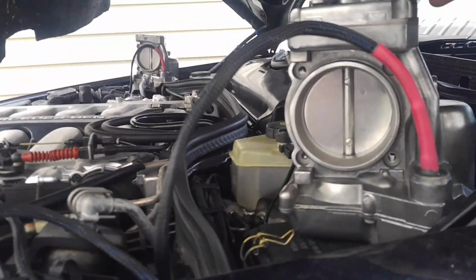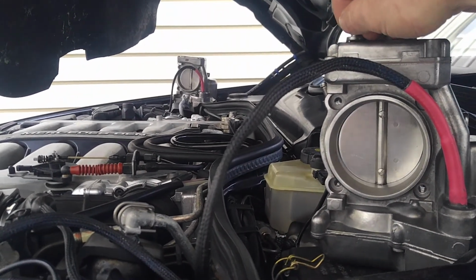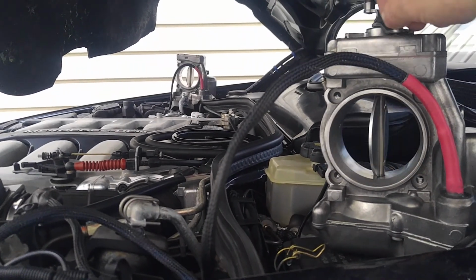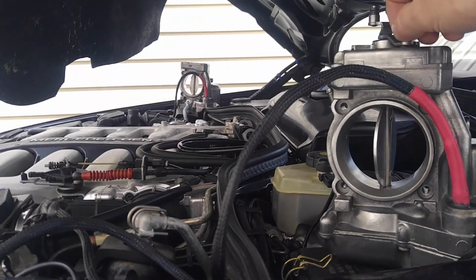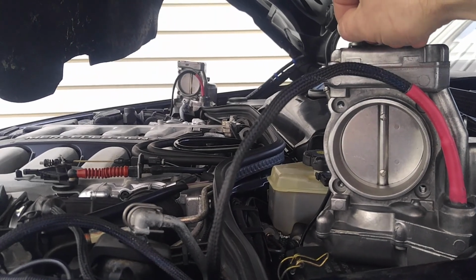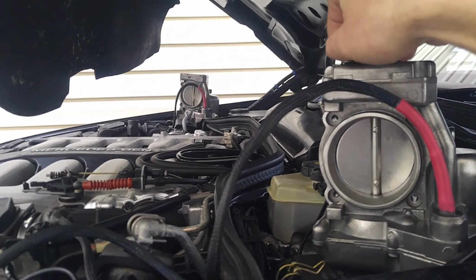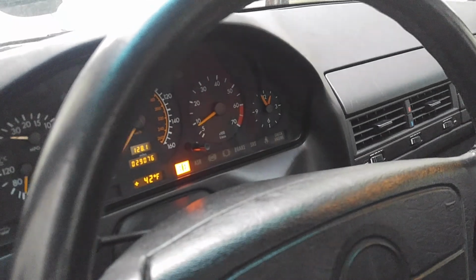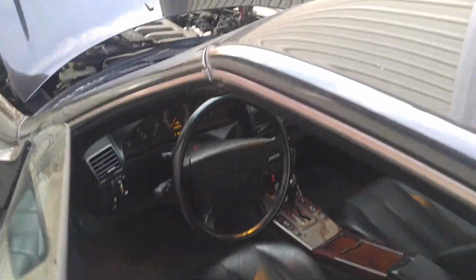See the throttles, I can open and close them real quick, but you shouldn't do this when the engine is running, because right now it's totally wrong air supply going to the engine. But for testing purposes, I can do that. So as you can see, both throttles activate, and there is no ASR light. Everything is fine. RPMs are high, of course, because I have no throttles installed. Basically, it's just whatever air passes in, that's what's happening here.